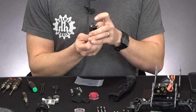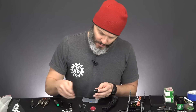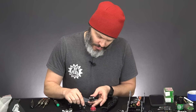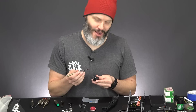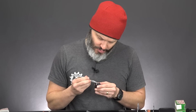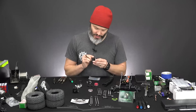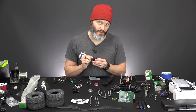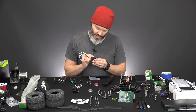The pinion mesh — we won't know until we bolt it together — feels really good. I'll add just a little bit more. Too much grease is a problem, and too little grease is technically a problem, but I usually like to err on the side of too little grease and it's never done me wrong. As long as the shimming is done properly, all we need is the thinnest little film. Too much grease causes too much drag, and too much drag will shorten your run times and burn out your electronics.